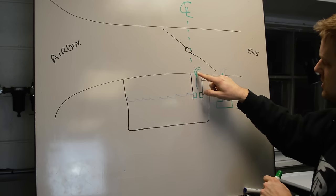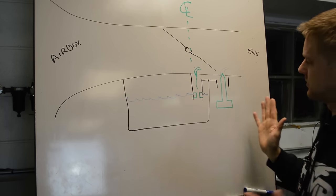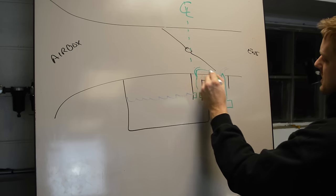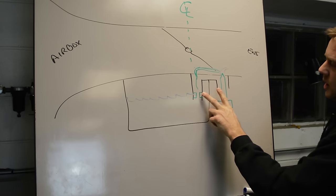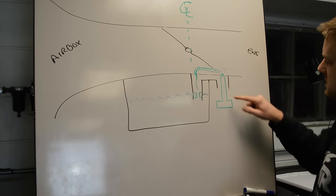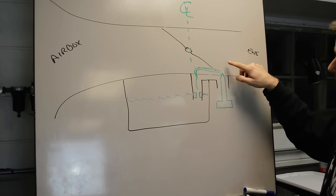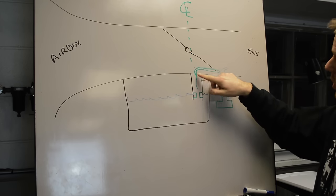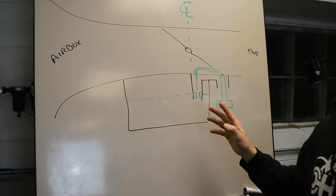Okay, and this hole is actually closer to the throttle blade, but in any case, I'm just trying to draw here. So that's what happens at a throttle. These two are important. Typically, when this is 2 to 3 turns out, trimming for maximum RPM and engine smoothness, then you also are going to have a good air fuel ratio at cruise.